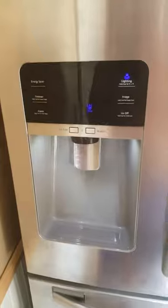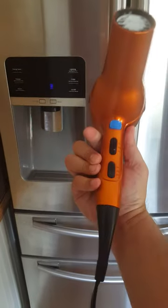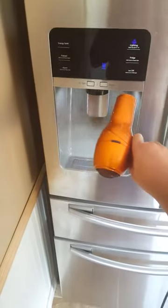But lo and behold, a little trick I tried — somebody said it might be humidity in the touch panel. So we take our hairdryer on hot and high, and I'm just hitting the front of the panel so the heat gets in the crack.